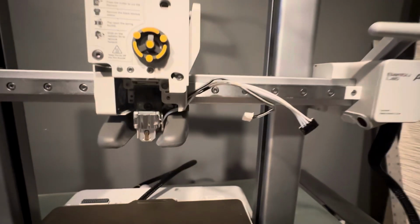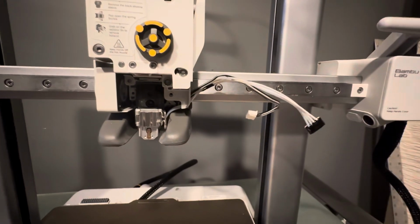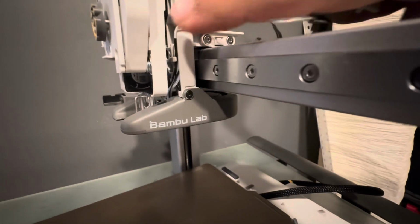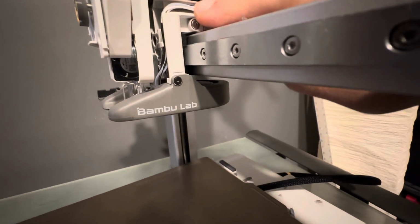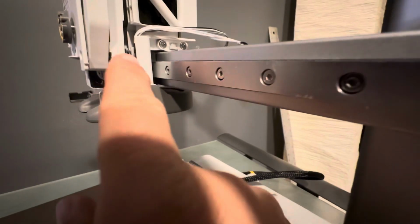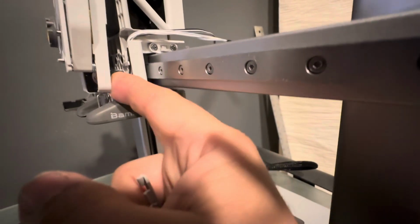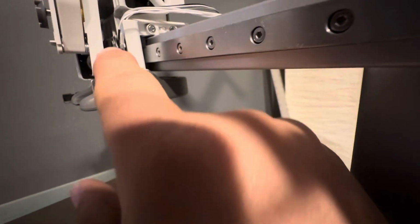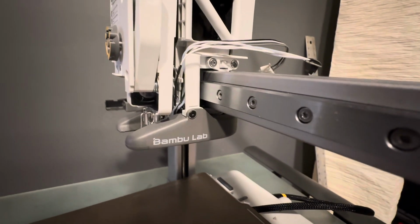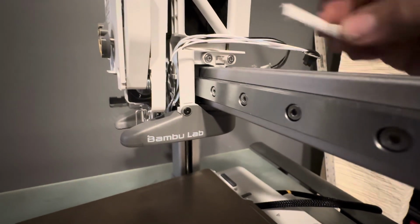But once you've gotten that, we're going to spin the printer to the side again so that we can route these wires up and back to the back. Routing the wires, it might be easier if you had like a pair of tweezers or something if you can't get your nubby fingers in there. If you give it a half a second and some patience, you can get it in there. You just need to make sure that you get it behind that little finger so that it's not going to get pinched or anything when you put the cover back on. See, there it goes. It popped out again. A few cuss words later. Here we go. After you get that, then you're going to slide the side piece back on to cover it up and hold it.